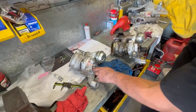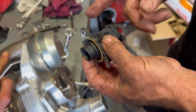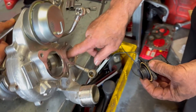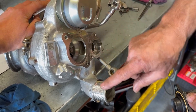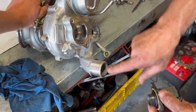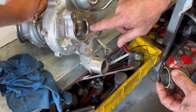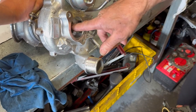The cartridge has been changed or upgraded - maybe ball bearing, which this is probably anyway. So what it basically does - that's like an electric solenoid, actually a stepper motor, so it's constantly winding in and out. That there goes against that, and as this energizes it pulls it back so the boost pressure goes back through there and back into the intake - through the turbo. What it basically does is stop back pressure going back and slowing the turbo down. When you back off, there's a lot of pressure not being used by the engine, and you don't want it pulsating back to the compressor wheel.